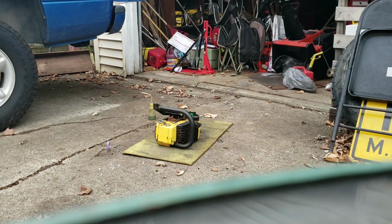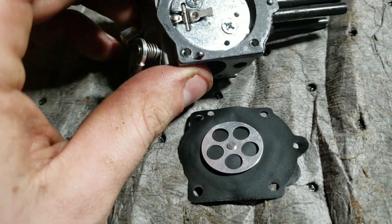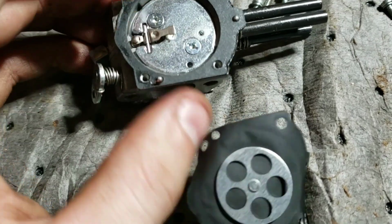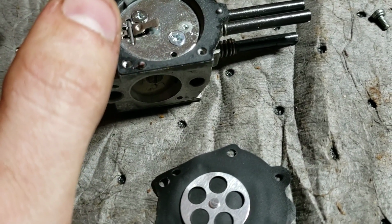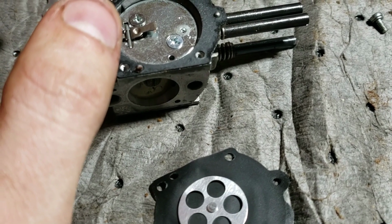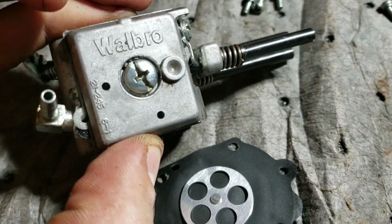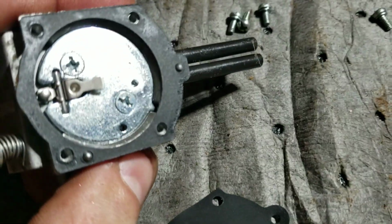Pump tank fuel. Now, I couldn't tell you if I've been in this carburetor before or not, but no fuel. Not pumping fuel, but I sucked on the gas line, and what came out didn't taste like gasoline at first. It isn't pumping to the carburetor, so we'll open up the back side of this and see what's going on. But this side is perfectly dry, and it's clean.